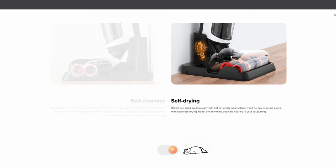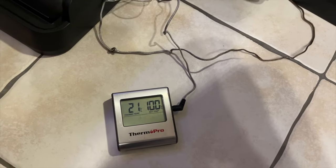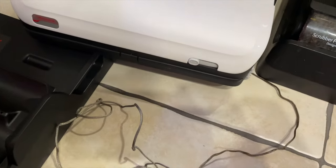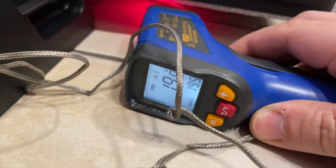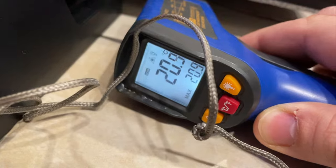On the point of heated drying with Roborock, I dedicated a good segment in my review to this topic where I said it's a feature that's falsely advertised. A quick summary: the Dyad Pro advertises hot air drying. In my tests using an infrared thermometer and a food thermometer, there was no hot air coming out — just regular air. I asked for a replacement unit, and it functioned the same way. I tried to get in touch with Roborock, they gave vague answers and then went silent, which led me to believe this is a falsely advertised feature.